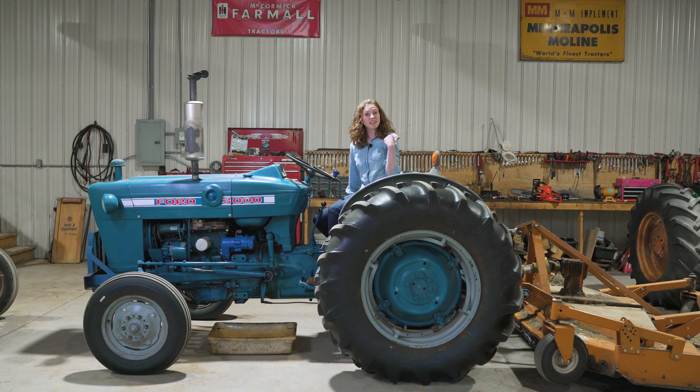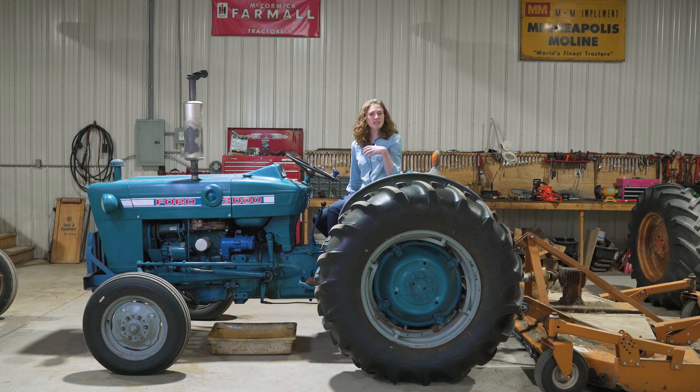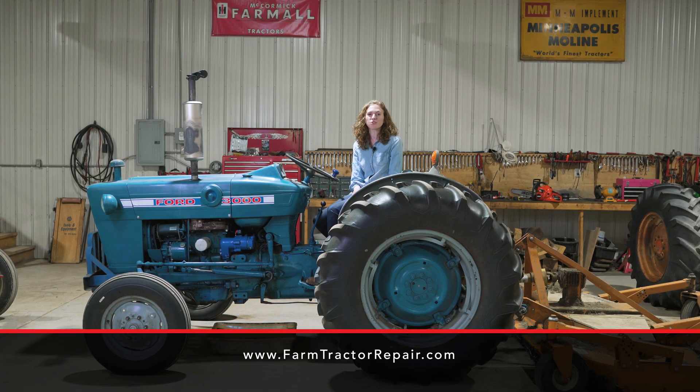You can see that the pump is staying dry — it's not leaking — and it's able to lift a really heavy load. This is a heavy mower and it lifts it with ease. We don't have any leakage in the pump; that's how it should be. I hope this video gives you confidence to repair your own high compression fitting, and that when you're finished it operates like mine does: no leaks, lifts and holds strong.